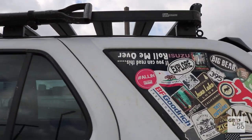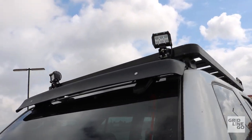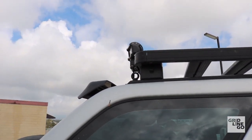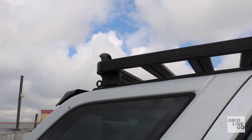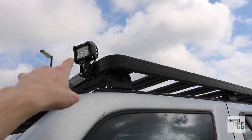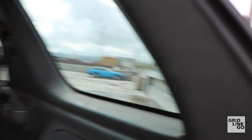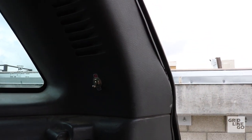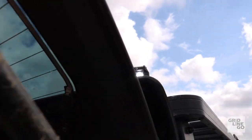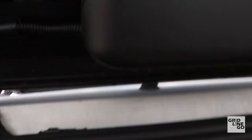Compared to the basket I had before, this rack isn't loud over bumps — no clattering. It's snug to the vehicle, like one piece. On top here I have the same seven-dollar fog lights from Amazon, wired to a switch in the back. I ran power from the dome light — just tapped ground and power — giving me nice bright lights on both sides via a jumper harness that runs between them.